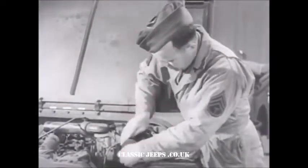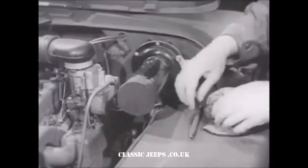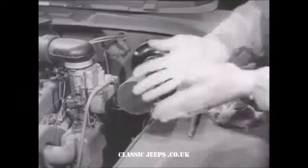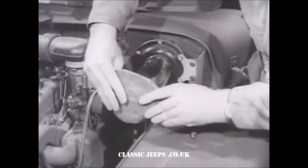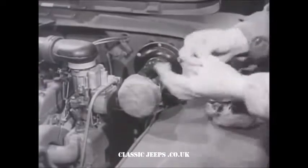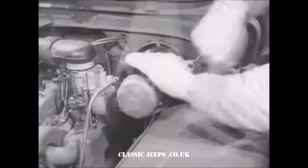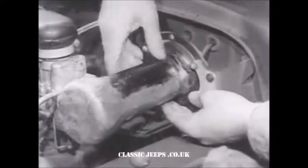Now for the horn, the Sunday driver's plaything. Overlapping pieces of tape are used to make a firm base for the compound. Patties of AWC, the correct size and shape, are then molded in place. When the mouth of the horn has been covered, the seams along its length are sealed. The compound must be molded into all holes, cracks, and seams to obtain essential watertight protection. And our Sunday driver's noisemaker is expertly silenced. It's been quite a workout, so the driver gives himself a breathing spell by sealing the horn button. A nice, easy one to do.